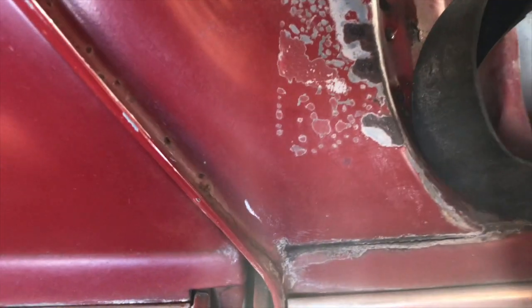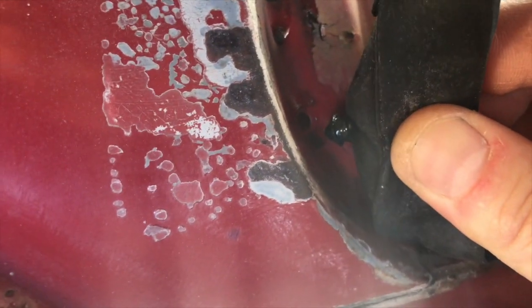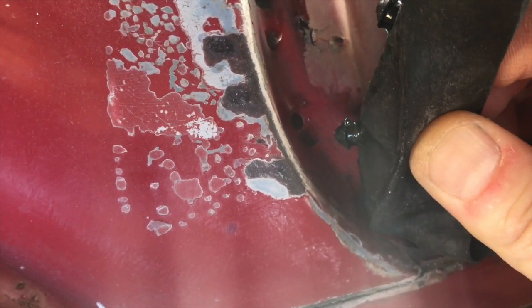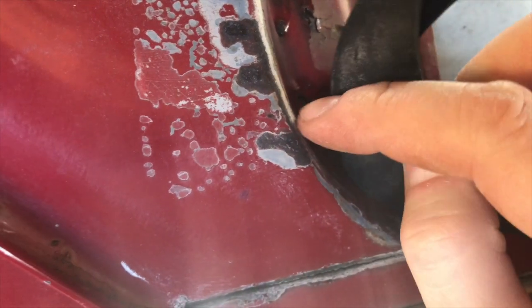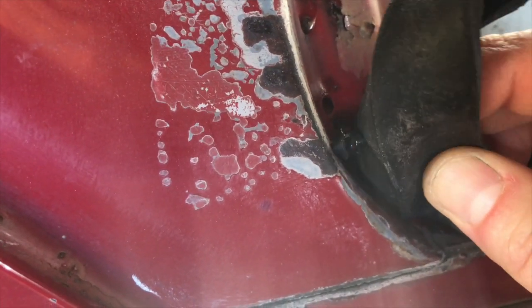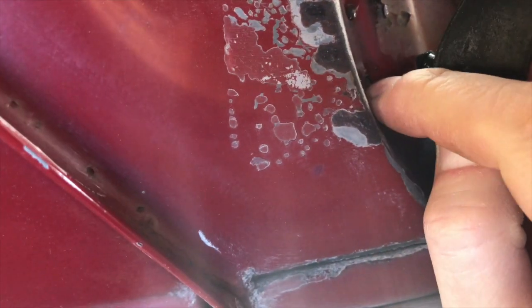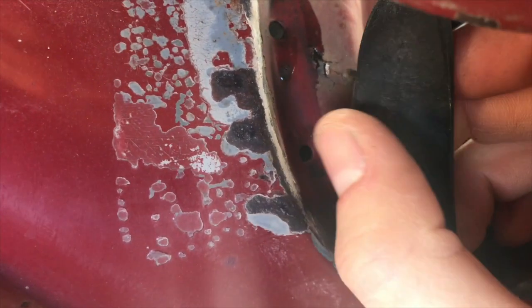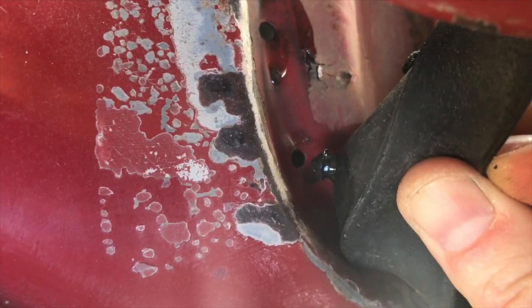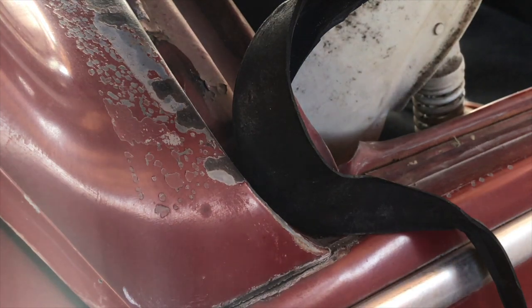I wanted to point out one of the tricks that I use. There's a little nubbin - a little knuckle - that sticks out of this seal piece, and there is a slot in the car that it has to go into. When I put pressure on it, it flattens it out and makes it bigger, so it's gonna have a real hard time going through that tiny little hole. So when I try to put something that's already too fat and put pressure on it, it's not wanting to go in.